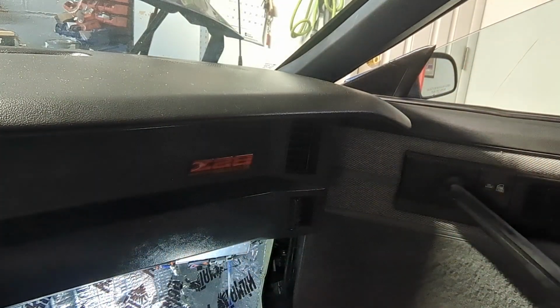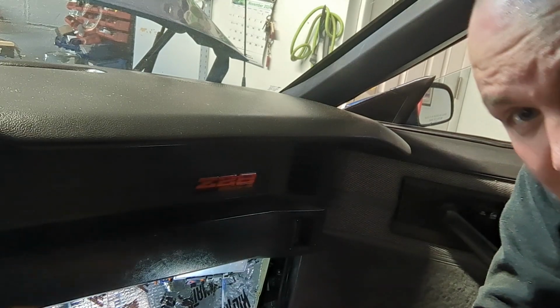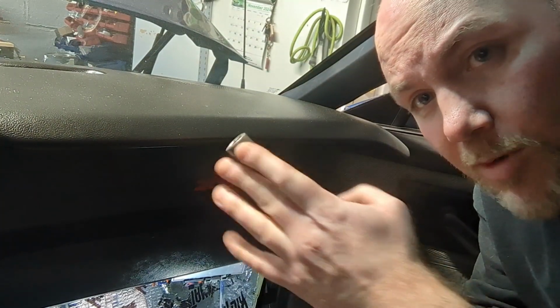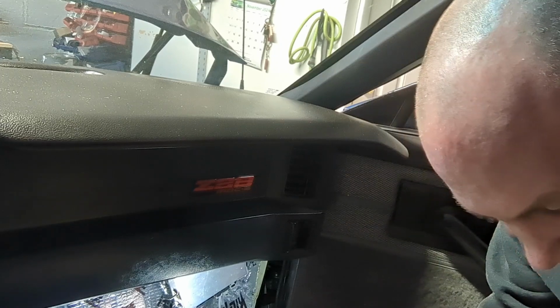It's going to take a little bit of persuasion. Alright, hang on tight. I'm going to have to screw it in, get it started. I'm going to put the 14 on the old wobbly socket, see if I can get it to screw through. Mingo. Alright. So what I'm going to do now is get underneath, put the nuts on and hit it with the impact.